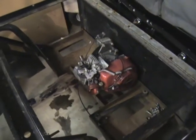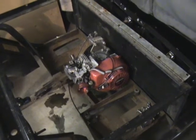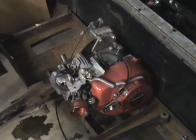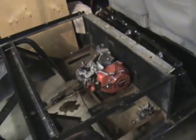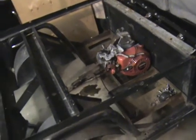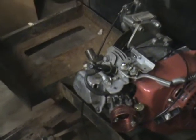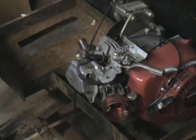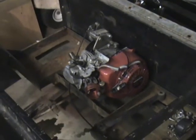It's a GX140 motor that, when I got it probably about 5-10 years ago, was covered in black stuff, completely not running, missing parts. Took it all apart, took it to a boiler room, swapped out the head for a GX200 head which has been shaved on a lathe so the compression's greater. It's port polished and the timing's been advanced.